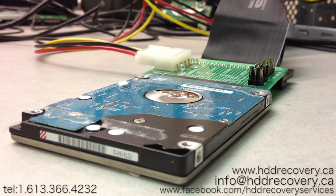How do we troubleshoot this? It's very simple. First, pull that drive out — if your laptop is not booting anymore, pull the drive regardless. Then go to a computer store and buy an IDE to USB or SATA to USB adapter, whichever your hard drive uses. These are readily available at any computer store or on eBay fairly cheap.